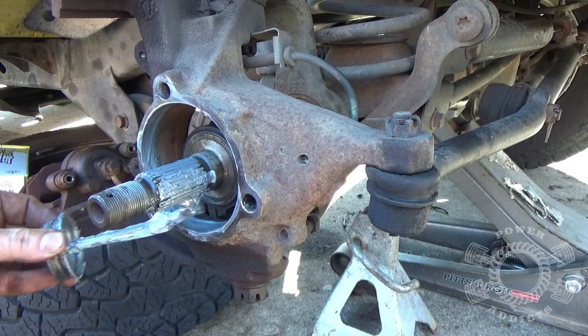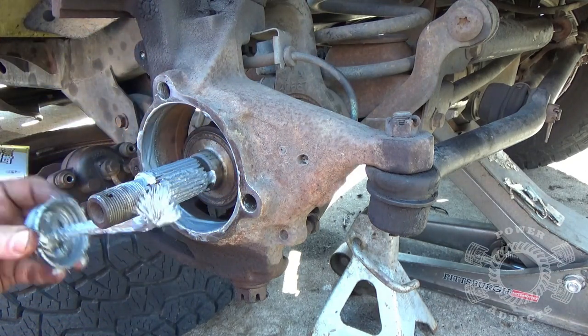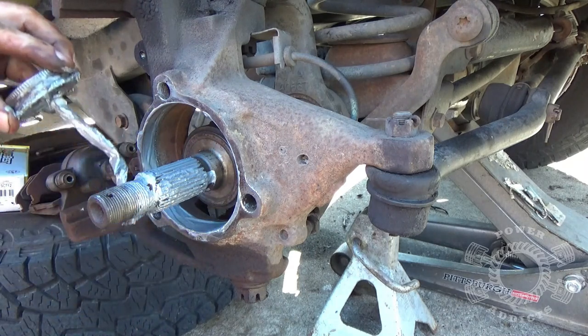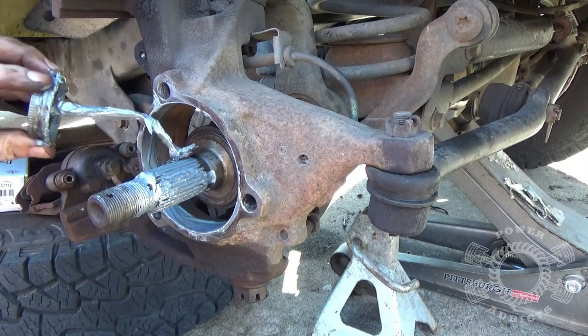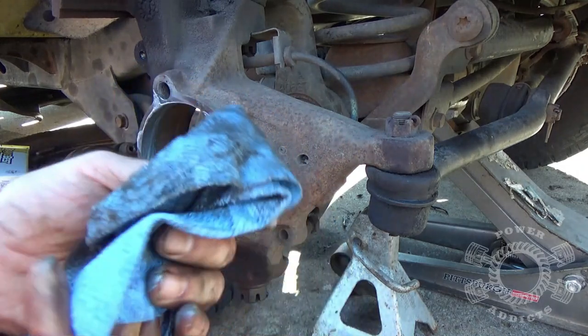Now for a very vital ingredient — yes it's an old can, but anti-seize never goes bad. Always, always use it right here, because you will thank yourself later. Whenever he changed that bearing a while back, he put the anti-seize in and it came apart very easily. Put it on the shaft and on the splines especially — that's where it gets stuck the most.